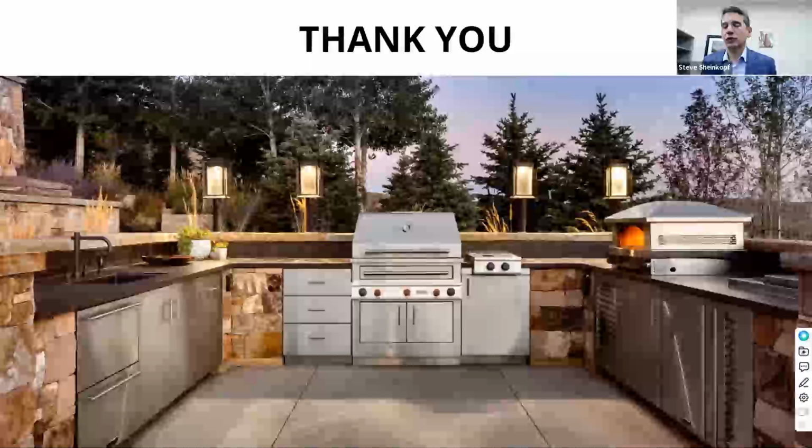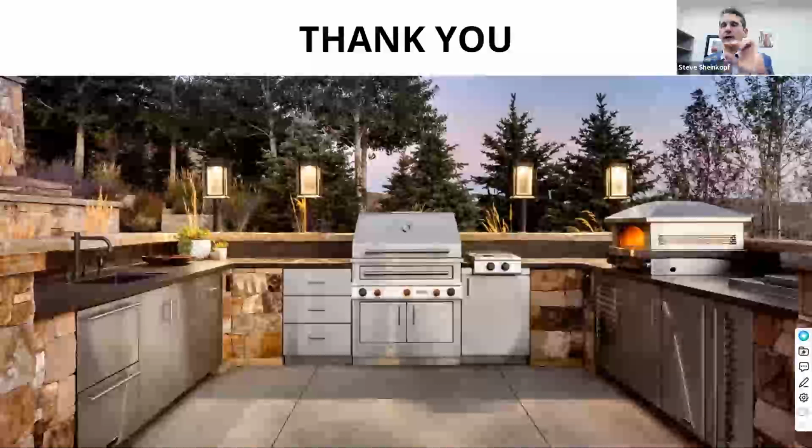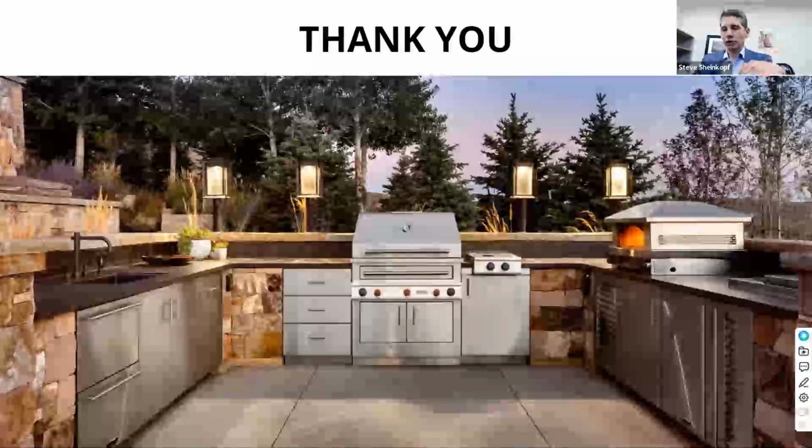But what they do, which is really kind of cool, and a lot of them do, Lynx does and DCS does as well, is Hestan has a variable infrared in the back, right? So as it's rotisserie, you're still getting that direct heat in back, and you go from 12 to 18,000 BTUs with the variable infrared, which is unusual. That's a pretty hefty rotisserie.